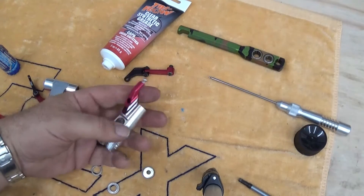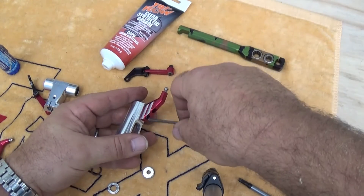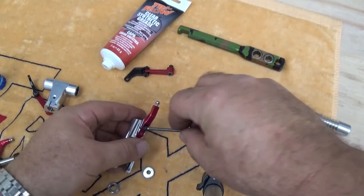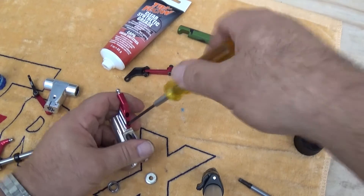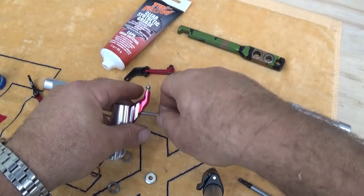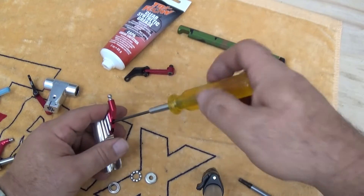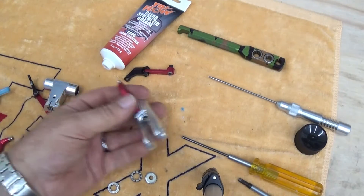So one and a half millimeter driver here. Around the side we've got the two grip arm bolts, three by eight millimeter. These got to come out and apply thread locker here. They're so small, you don't want to put a whole bunch of torque on these. You can strip out this grip arm if you're not careful, but with standard hand tools, still snug it pretty good. We got two bolts here. Get a little bit of thread lock on that one. I'm always using the blue kind, the medium strength — you want to be able to use something that you can actually take off with hand tools.